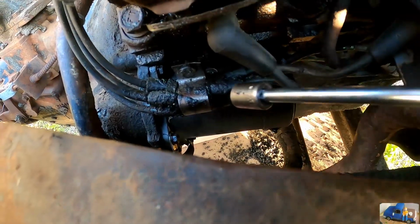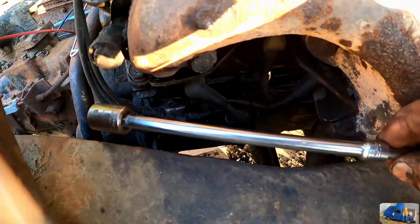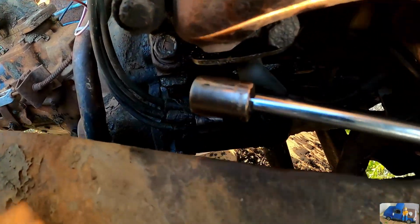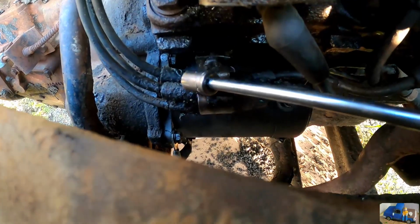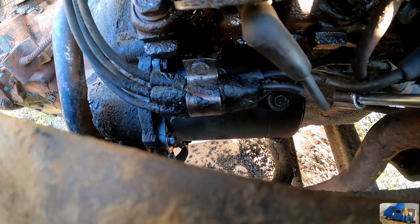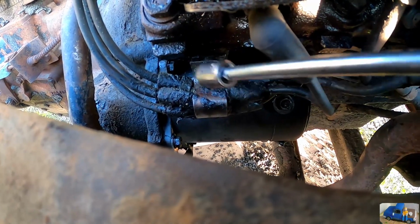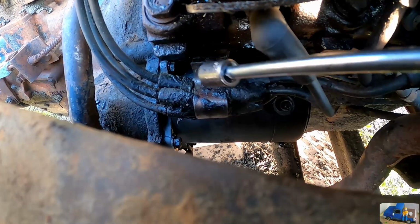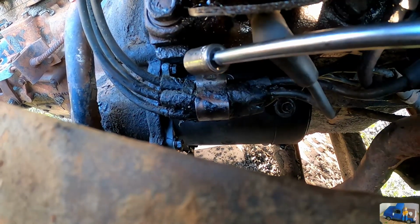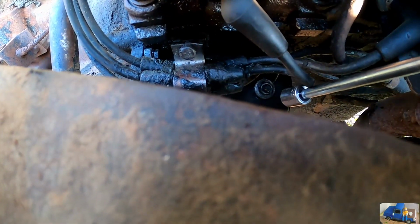She is in there. The tricky part is that top bolt up there, and the trick is 1/4 inch drive extensions with a short socket on the end, and you can reach up there and get that top bolt started with your fingers from this direction over here. If this was in anything other than a Cabover, I don't know how you FE guys get that bolt, because I was staring straight at it and I had a rough time getting it.